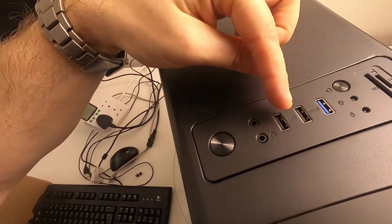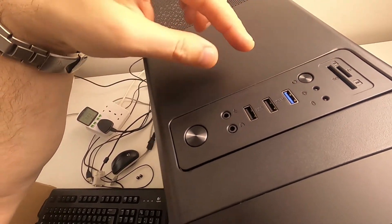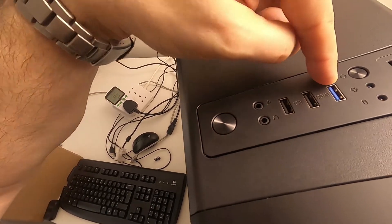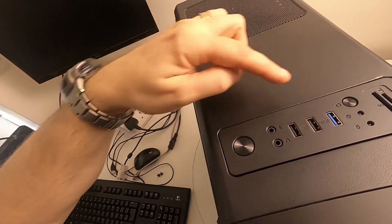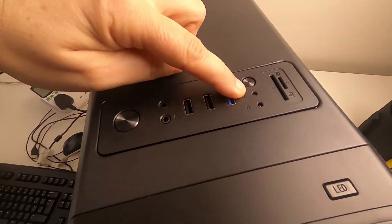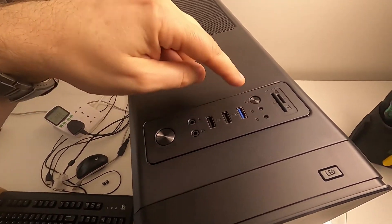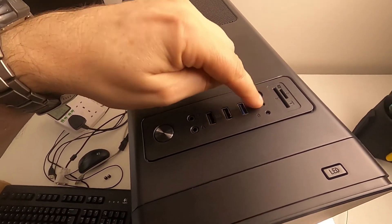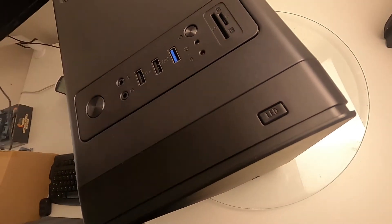Each is a single connector, and most motherboards have one USB 3 header and two USB 2 headers, so it all works out perfectly. The card reader actually works too. There's also a power LED right there.